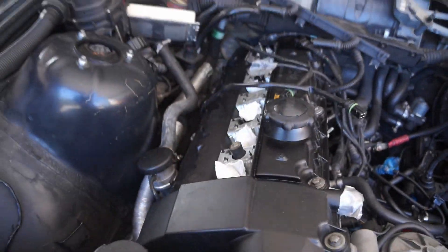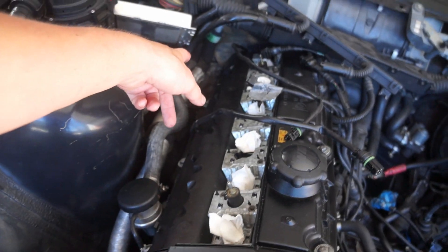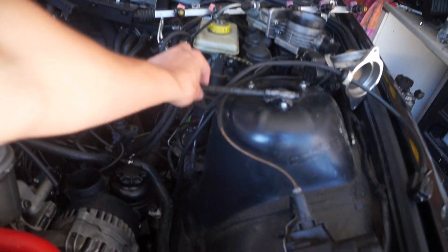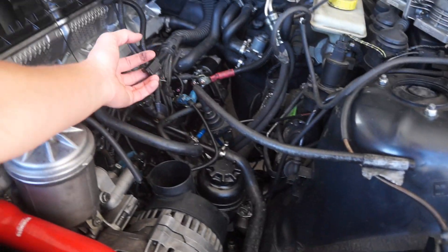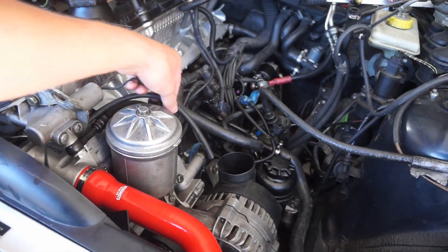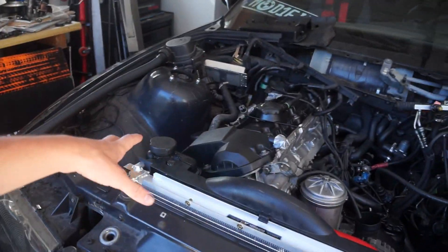So we got a lot of work to do today, just a lot of minor stuff, and then mainly just the intake manifold. There's lines and wires and vacuum routing, all that stuff. Some of the little stuff: I need to get the ground wires for the ignition coils on, little coil harness, I need to put the engine control unit back in, and then we've got to put the intake manifold back on. I've got to put all my vacuum lines on. There's a bunch of sensors on the intake system that need to go back on as well, the O2s, secondary air pump, all that stuff.